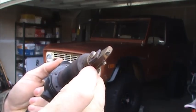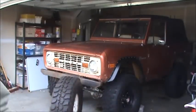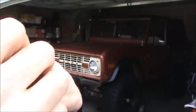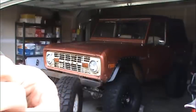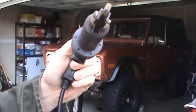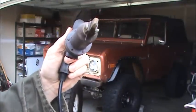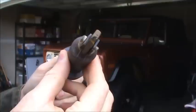So what you can do is go ahead and take the blade out and flip it upside down. Bear with me for a second here — it's still got the screw loose. If we flip it upside down now we can just run this right through the lugs of the tires and it's just going to put a couple of slits in each lug. And that's what we call siping.